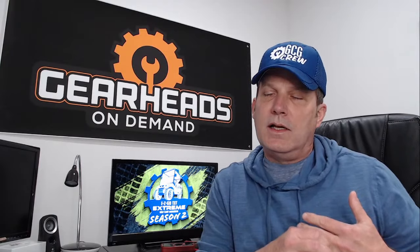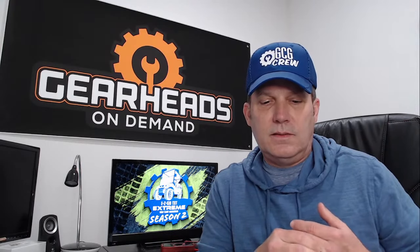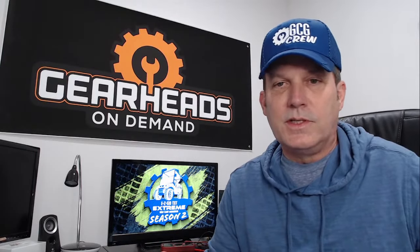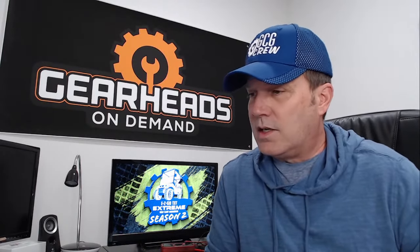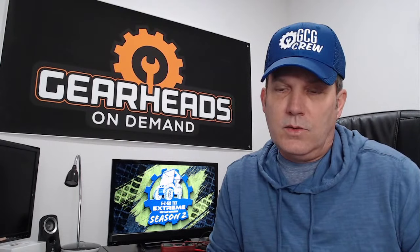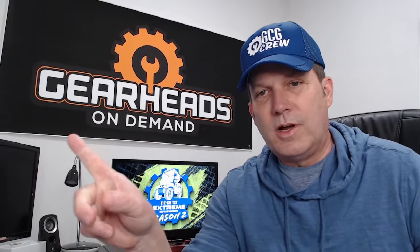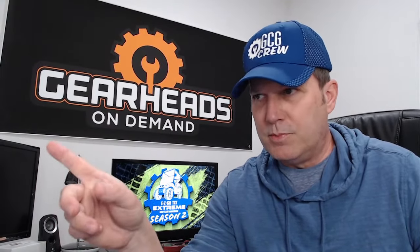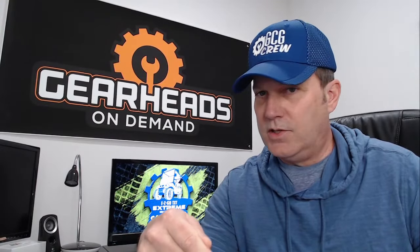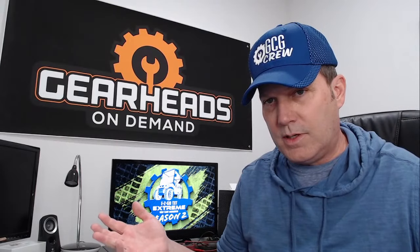Okay, Dwight, I understand your question. I'll tell you what it says deep inside the service manual. Not too many people even know this because they didn't read that deep into it. On a 48 volt Club Car that has an onboard computer, when you plug your golf car in, it will charge and the needle will go up to about 15 amps, and then slowly drop throughout the night, and then it shuts completely off, and you walk away for 1.5 months.